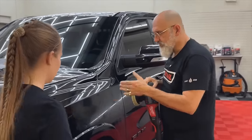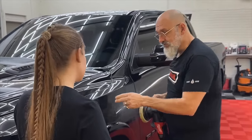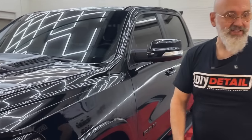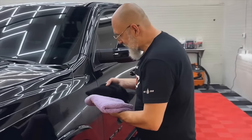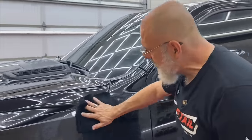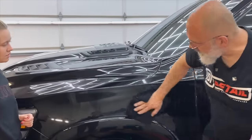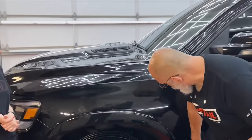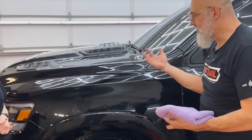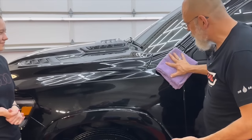All right. So before we do that, we'll wipe this off so you can see before and after. Because everybody likes a good before and after shot. Absolutely. We have a rinseless dampened towel. That makes the polish much easier and smoother to wipe off. So we're not working hard to remove it. We're not putting any pressure. Therefore, we don't have to worry about inducing other scratches.